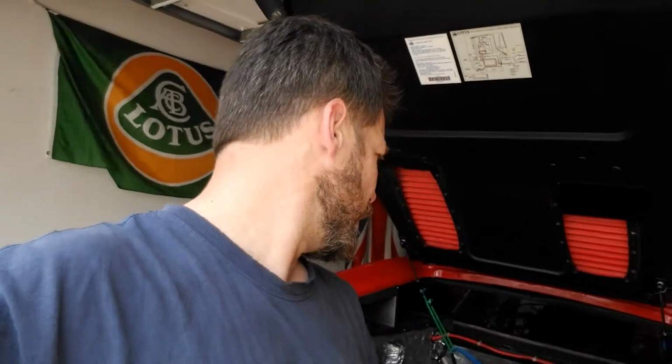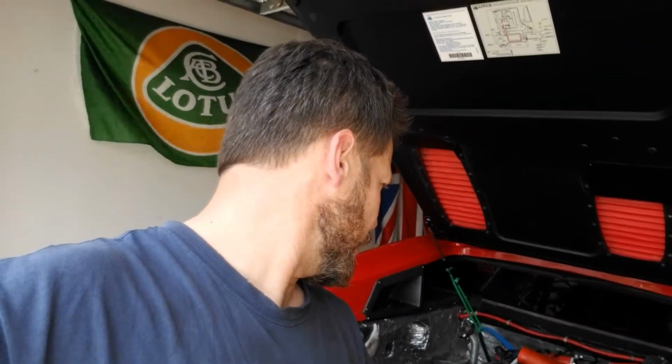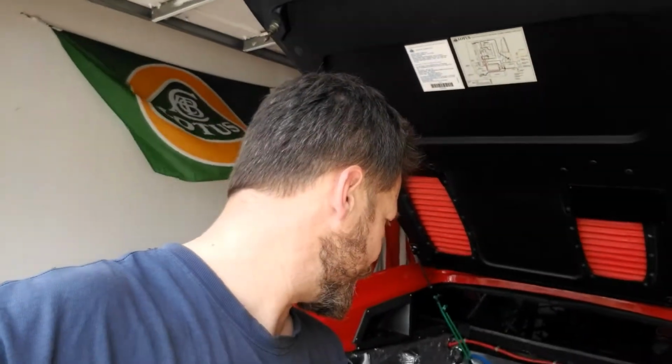So anyway, there's a couple pulleys that I could not torque down because doing so would turn the crankshaft, and I don't want to do that. So I'll wait till I get the cam towers and sprockets back on with the timing belt on, and then I can lock the crank down, and it'll keep it from moving so I can tighten those down. Other than that, I'm going to replace that hose today.